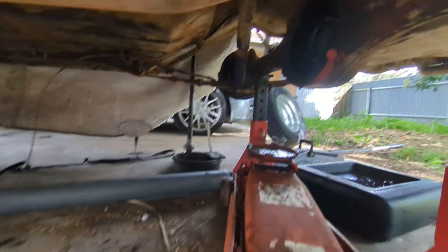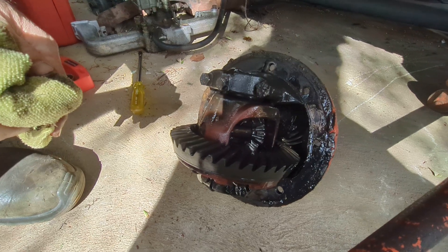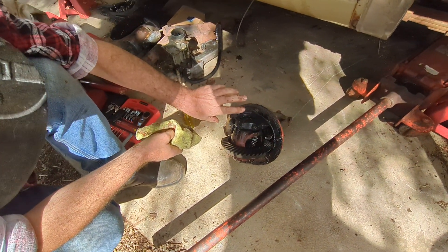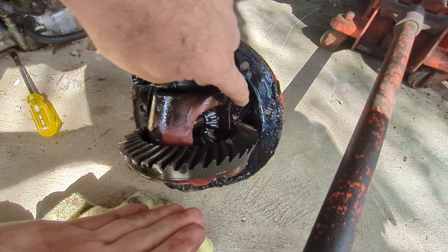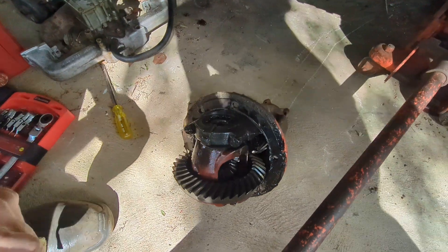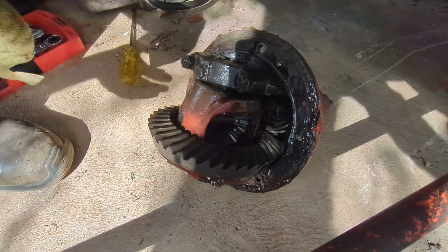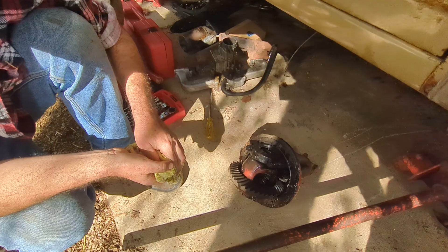There are adjustments — I learned about this stuff a long time ago, about 40 years ago. There's a relationship between the crown wheel and pinion and it's adjustable. I think it might be shims. It's whether this gear is in or out into the mesh of the pinion, or the pinion is in and out. You'd mark these with bearing blue and see where they touch between the two gears.